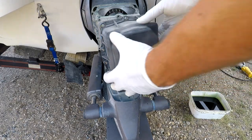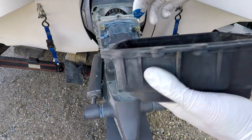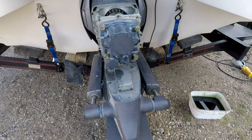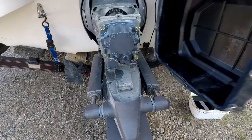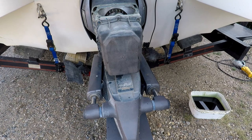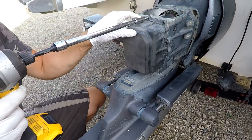Here's the cover that goes back on — it has an O-ring seal that goes around it. I'm going to use some Amsoil synthetic water-resistant grease to lubricate that seal, hopefully to keep water from coming in. Just give the O-ring a light coating. It just slides back on. Then there are the 10mm hex bolts that came out. You want to start at the middle and work your way out, just like torquing anything else. Put the first one on loose so you can align the other holes.